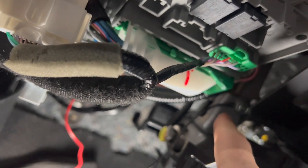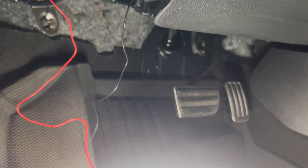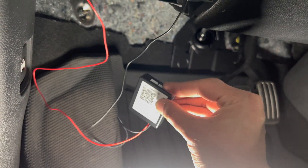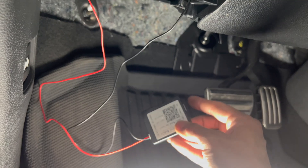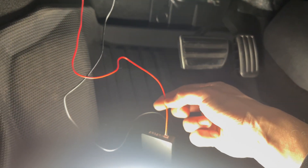I used ground right over here, which is closer — 10 millimeter. That's ground right there. We plugged it into the main controller. Now we're going to connect the forward lights to the subcontroller so we can hide all that stuff in the center behind the panel. I'm going to splice this wire — cut it, shave off the sides, and connect the other connector for the subcontroller, plus the ground. Two controllers will be getting power: the main one and the subcontroller.